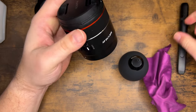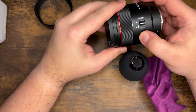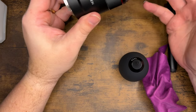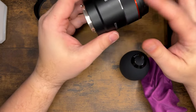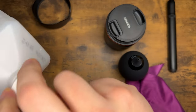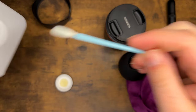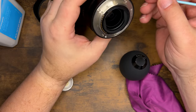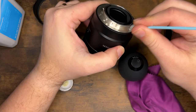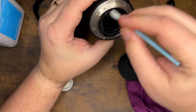Your lens is done — make sure your switches work and so forth. As far as the barrel of the lens goes, if you really want to clean it, let's get some isopropyl alcohol. I'm using 70 percent — you can get it in different percentages. Right here is a spot that likes to get junk build-up in it, and I will take this and clean around here with some isopropyl alcohol. Do not get up on the electronics with it — that does not need to be cleaned unless you're having a problem.